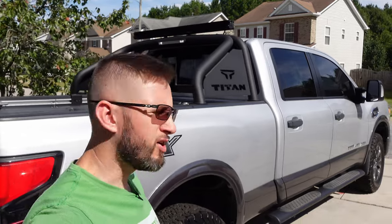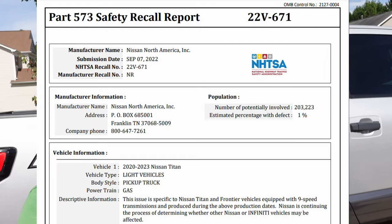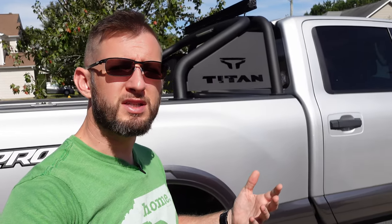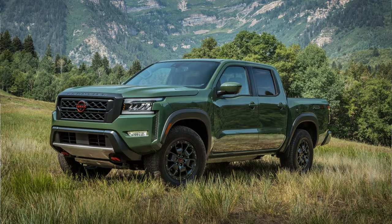A very easy adjustment — this is not something you're going to have to do very frequently. I use the emergency brake just about every time I park the truck; that's a carryover habit from when I used to drive ambulances getting into high idle on the diesels. This truck is about four years old with a little over 40,000 miles on it, and this is now the second time I've adjusted that brake lever — it's been holding just fine pretty much the whole time. Make sure you do this on your Nissan Titan, especially with the nine-speed until this recall gets done. The same is going to be true for the new Frontiers as well, because they have that nine-speed shared transmission.